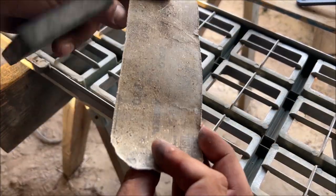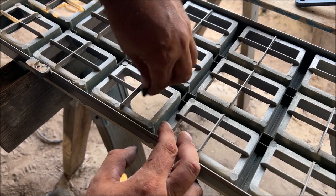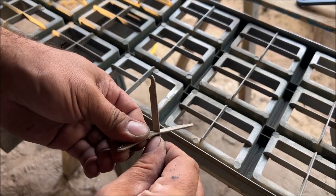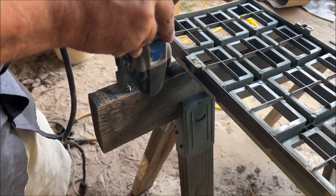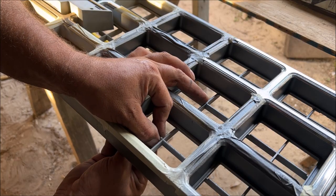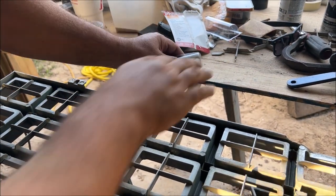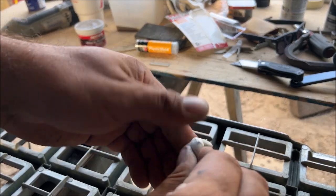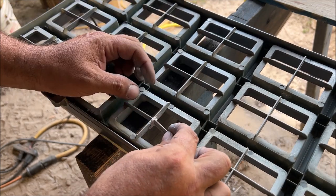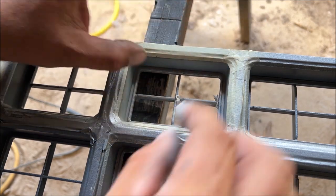Using the sanding block with 80 grit — this is an old piece — we want to sand it flush or flat, then clean the other side up with some steel wool. The donor piece needs to fit in there like a puzzle piece, kind of snug, so be careful how you break it off — you don't want it to be too short. Sand it down until it fits perfect. Once it's holding good enough, clean all the areas up. We're going to use JB plastic weld — cut a little piece off, mix it together with your hands. This stuff sands super easy, so don't be scared to use a lot. Work it in there real good and don't worry about it squishing out. You can feel this stuff getting hot.